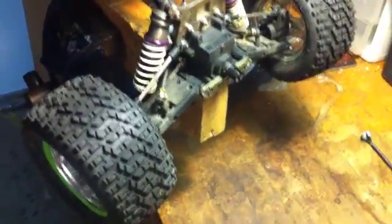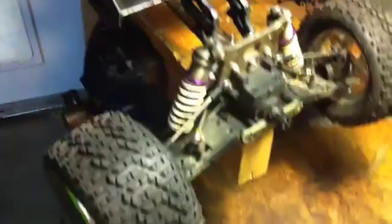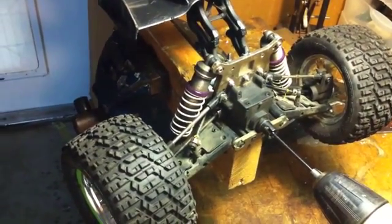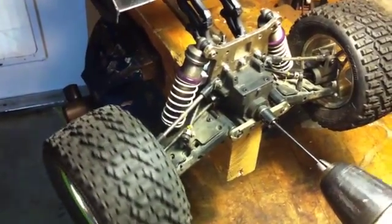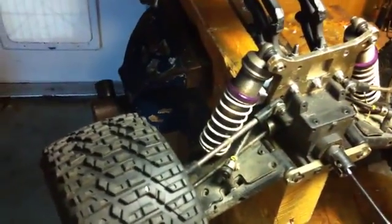Let's say I was trying to figure out why the back is not running right, not running smooth. In this case it's going to be very extreme because I've removed the droop screws, so this is going to rub. Just to show you — if I wanted to test it, you'll see that one side is worse than the other. Nothing should stop that fast; as soon as you do it, it should roll freely. I can simply turn and say that one's still turning, that one's not. So now I know I have a big problem here and a smaller problem here.